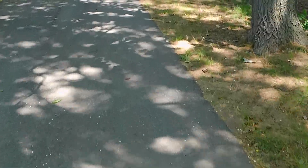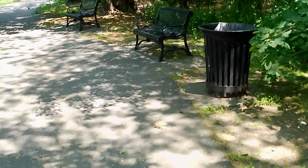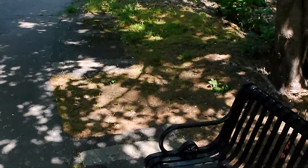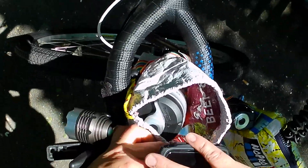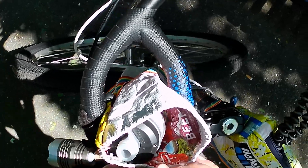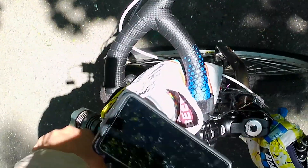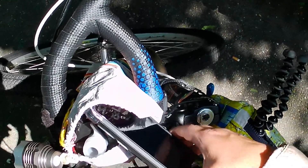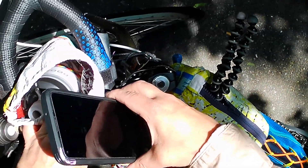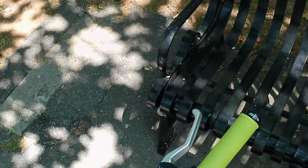That will take another 15 to 20 days to get here. One final bike update: the tires I put onto the Kona so I could go up to 10 speed are horribly out of true. I trued them up the best I could, but I think there's a dent on one side that I don't have the tools or know-how to pull out. I'd probably need a truing stand, or I could take it to the bike shop. But the tire that came with the bike is in very good condition — it's very true. The previous owner had it tuned up. So there's a $25 part I can buy to turn that wheel set into a hub that will accept my 10-speed cassette.